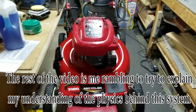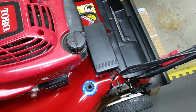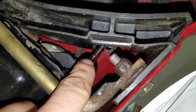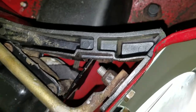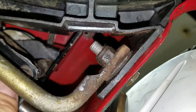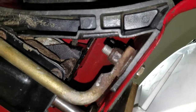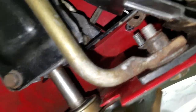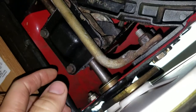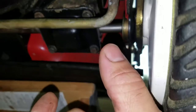The next day I've already started getting it assembled a little bit further. I figured if you're still watching this you're probably interested in a little more about how it works. From my viewpoint it's very similar to a governor on an engine - if you pull on the spring it'll pull harder on whatever it's attached to, like this gearbox. Like the governor system on the engine, which has two counteracting forces - the spring and then the weights inside the motor. It dawned on me that this gearbox, being that it's not attached to anything, when this gearbox outputs torque, for every action there's got to be a reaction, so it's actually turning the gearbox the other way. So essentially there are two actions working against each other.